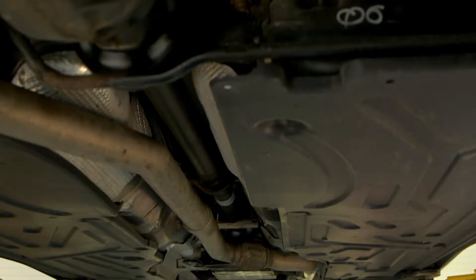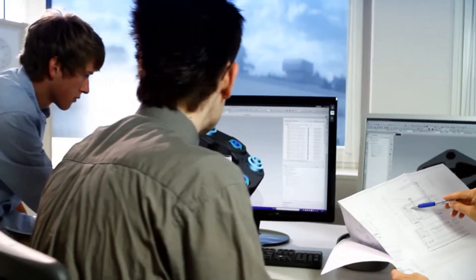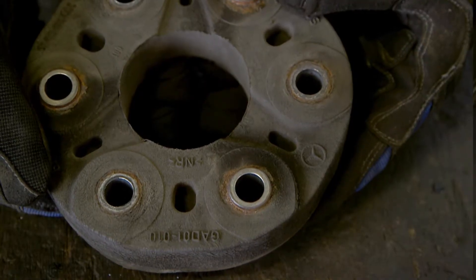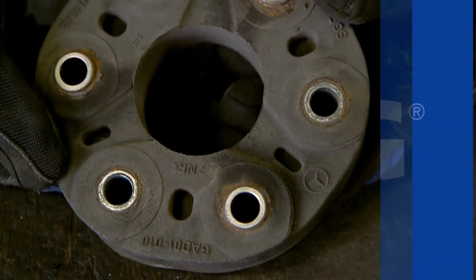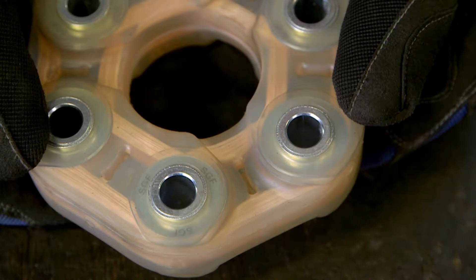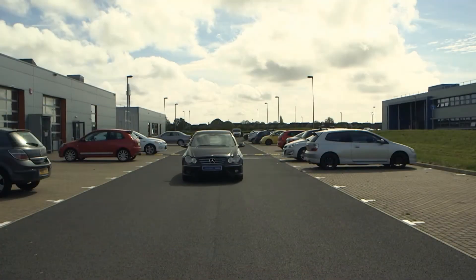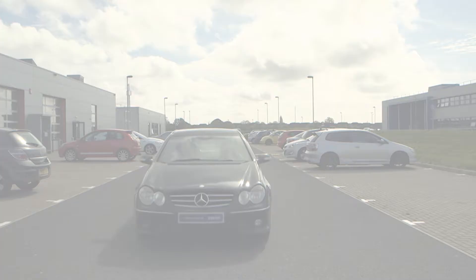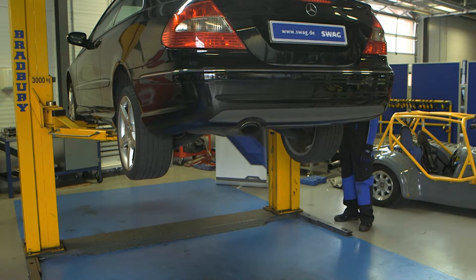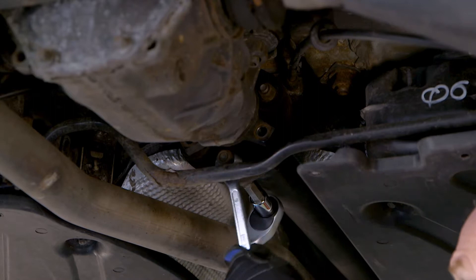With all of the engine's torque being transmitted through the prop shaft, the design of this flexible coupling is important, as this joint absorbs impacts and shock forces, reducing drivetrain disturbances and preventing angular misalignment, which has an effect on the vehicle's noise, vibration, and harshness characteristics when driven over different road surfaces. The component endures a tough life during operation and should be inspected during regular servicing.